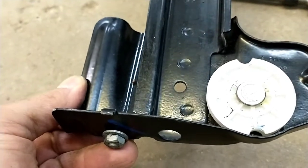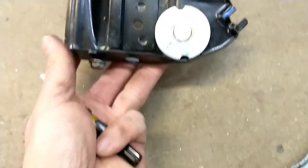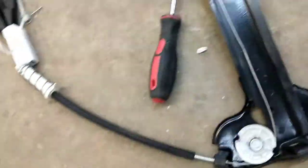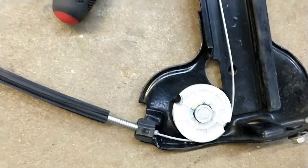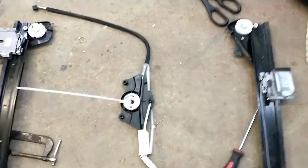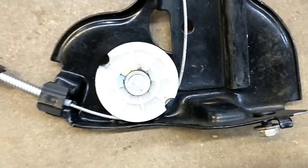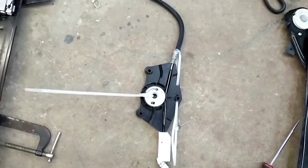I had to return one. The convertibles have a bracket with a screw on the bottom and it's pretty heavy. The repair kit I got had parts that were a lot shorter and weren't shaped correctly. They do make wire repair kits, but it won't go on over the rollers — it's about an inch too short. After researching online, it appears there are different size pulleys depending on the year, and I happen to have the taller ones that don't match this wire.